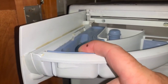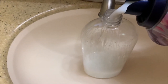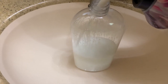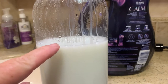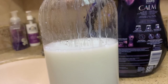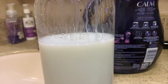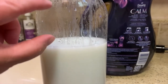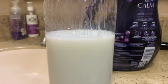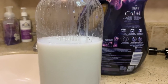Next we're going to talk about the softener, used in compartment number three. For softener I also use a squirt bottle, since it only suggests one to two tablespoons. Splendide recommends using bio-friendly fabric softener or a similar brand — these softeners appear light in color, dissolve more quickly in less water, and minimize buildup within your machine. Mine is a little thicker, so what I do personally is add a little bit of water to thin it out. That's not Splendide recommending it — just telling you what I do. They recommend the bio-friendly or lighter-looking softeners.